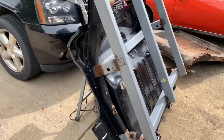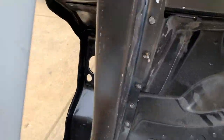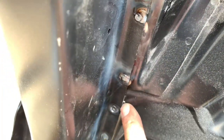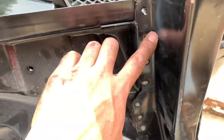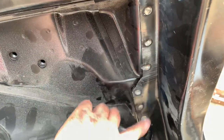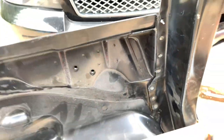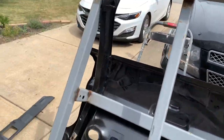All the plug welds from the bottom side are completed. If you get them out and lay them up, they look pretty nice — completely flat, very similar to the factory spot weld. So no buffing required. The only thing I'll do is clean it up — I plan to sandblast it to get off any contamination. That'll weld and paint real nice. No need for buffing on these if you get them laid out pretty good. Next thing is lay this thing back flat and do the same thing from the top side.